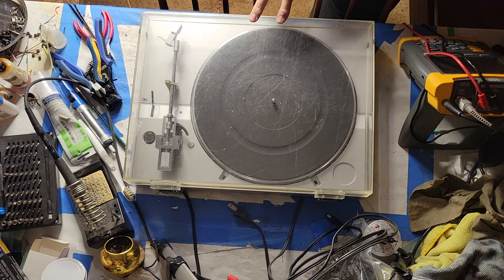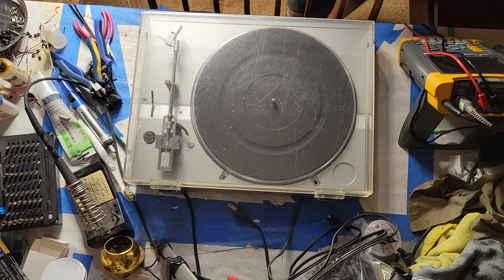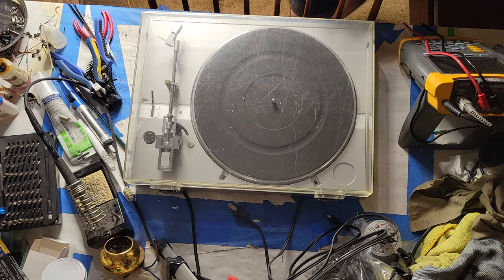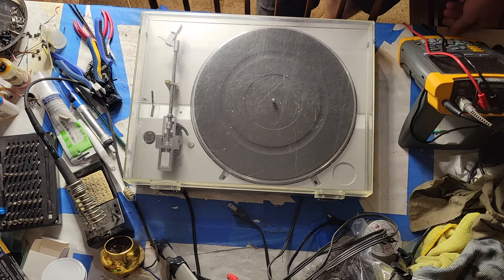Now, what if the person trying to sell this turntable came to me and said, here's a turntable I just picked up, I don't really know if it works, I want you to check it out and see if you can get it up and running? I would proceed through with the disassembly and try to get it running. I would run into this issue of no sound, and I would say, do you have another turntable with a P-mount cartridge so I could swap one in? I don't have another P-mount cartridge to swap in to confirm the problem, but that would be the next thing to try. Try another cartridge — if that works, go through the disassembly of the gears and get those tuned up. There's probably nothing terribly wrong in here; unless I find a broken gear, it probably just needs to be cleaned up and lubed.